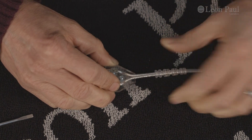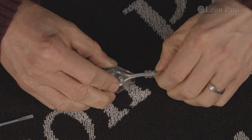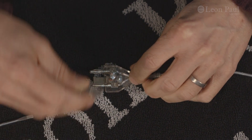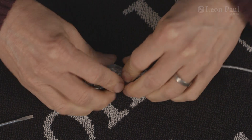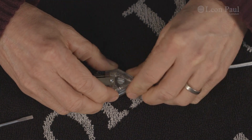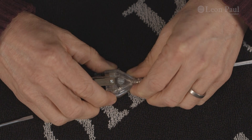You can take that out and replace your strain relief if you need to. If it's broken, you can just put a new strain relief in and that's captured inside here. And then to put it back together, instead of needing an octopus to help you hold all the bits, you simply put it back together like that and do up your one screw and you're ready to go.